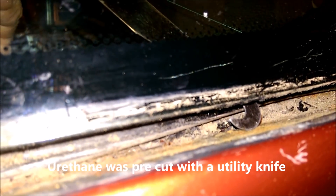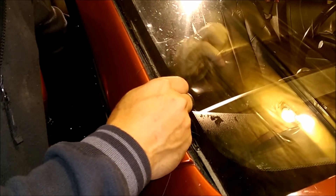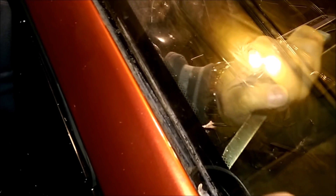Essentially you just insert the chip chaser right there, then insert your fishing line through or onto that hook and pull it inside the vehicle. So we're just going to feed this through the windshield. I've got that little slot cut, and you can see the blade comes right up to the top. We're going to hook onto that blade and pull it through.